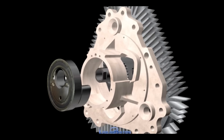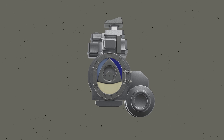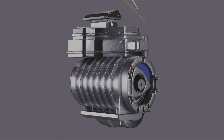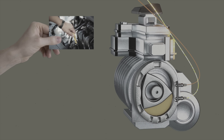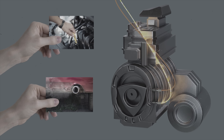The reason came down to inherent design flaws with the rotary engine. For example, it has lower thermal efficiency than piston engines because of its long combustion chamber, which often leads to unburnt fuel leaving the exhaust, causing the engine to backfire — original Mazda Cosmos owners know exactly this. Rotary engines also burn oil by design, since oil gets injected directly into the combustion chamber. So you have to regularly check oil levels to keep the rotor lubricated, and you'll see more emissions coming from the tailpipe.